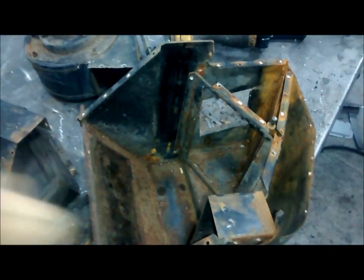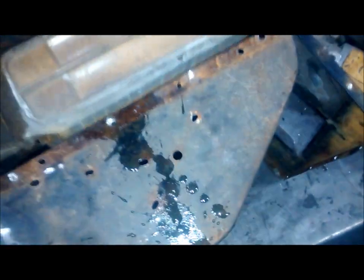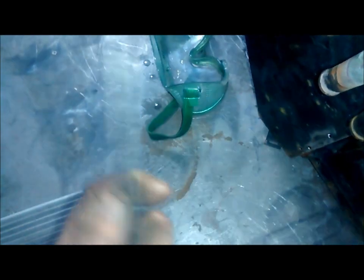This has got to be stripped down completely, and because it's a right-hand drive we're going to make it into a left-hand drive — invert all the panels. I've taken the heater box apart; there were several spot welds all over the place. I use this little tool to break spot welds — I drill them first and then use this very thin chisel. It's actually a furniture-maker's tool; it works very well, nice and hard steel.